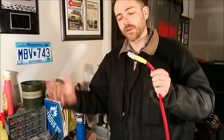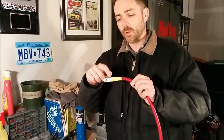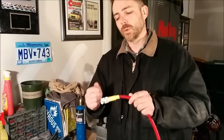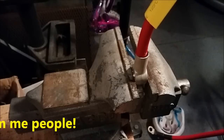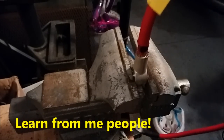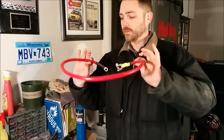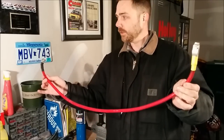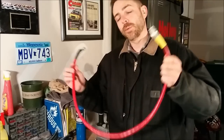So there you have it — pretty simple. Solder, a little bit of heat, a little bit of patience. Remember, when you're putting this in, always let it cool to the touch. If you pull it out too quick, it's just going to yank all the solder out and you're going to have to redo it. Make sure she's in there nice and tight. There you have it — perfect custom length, exactly what I needed. I'm going to go put it on the car. Don't forget to subscribe, and thanks a lot. See you guys later.